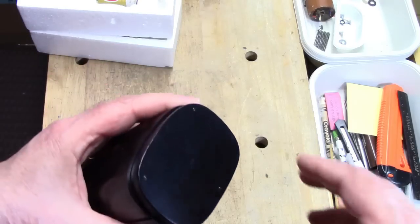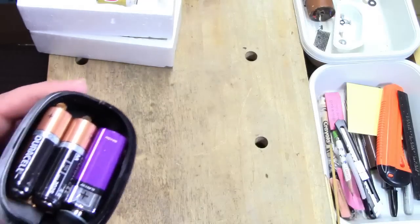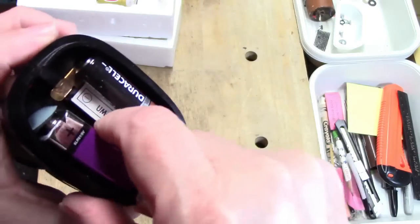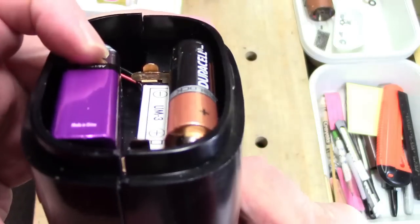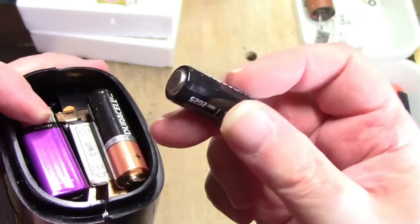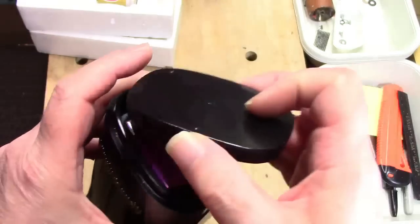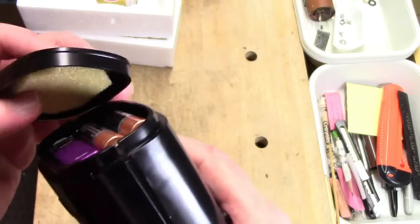To get to the batteries, it's the bottom of the tape recorder — it lifts out. There's some foam to hold it in place, and this is a replacement foam. Here are the batteries. The front part is a standard spring like you would expect, but the bottom of the back — look how short that is. It just barely touches the back of this battery. But on the old-style battery there was no problem. I'm not sure why they structured it that way, but we just squeaked by with modern batteries so that the machine actually works. Then we just put the bottom back on — it snaps in place.